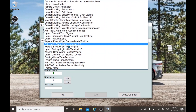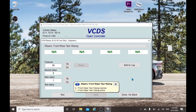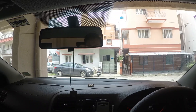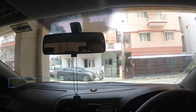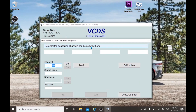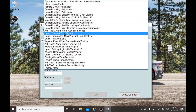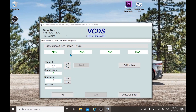Next, we are going to activate the Teardrop Wiping feature. What it does is that after you press the windscreen washer stalk behind the steering wheel, some droplets tend to remain even after wiping. With Teardrop Wiping activated, the wiper will automatically wipe once more after the standard cycle is completed, clearing any drops left. The next feature is the Lane Changer. Normally a single tap on the indicator stalk activates the lane changer, which typically flashes the indicator three times. You can increase it to five repetitions. Click on Comfort Turn Signal from the drop-down menu, give a value between one and five, and then click Done.